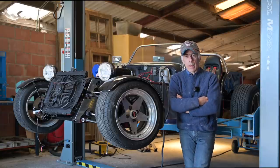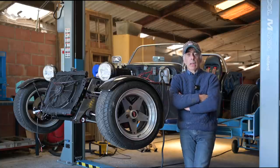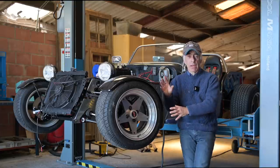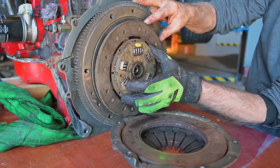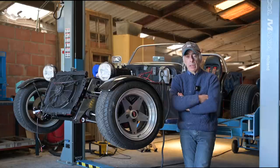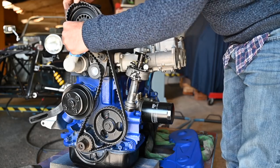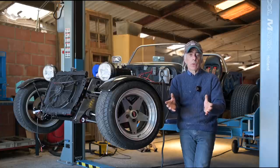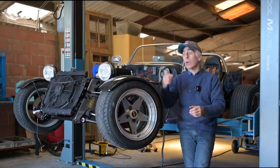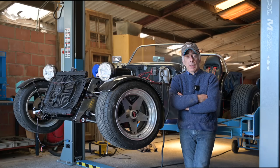Hello folks, welcome to the channel or welcome back. In this video we're going to work on old sporty. We've already done a lot of work on this vehicle — we fixed and replaced the brakes, rebuilt the calipers, took out the engine because of a clutch problem, changed the clutch, pressure plate, bearings, and crankshaft seals to avoid oil leaks. We put it all back together, adjusted and replaced the timing belt, and rebuilt the carburetors, which were Weber DCOE 40s. Those are newly baselined and rebuilt, and they'll go on the engine in this video.